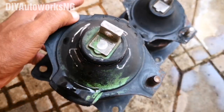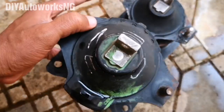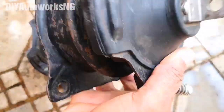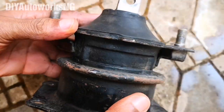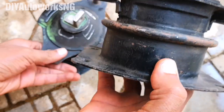If you shake the OEM, you may be able to hear the oil squishing around inside — it's pretty obvious if you hold it to your ear. A lot of aftermarket parts won't have any oil chamber — they're simply a solid mount with nothing inside to indicate any oil for increased dampening.